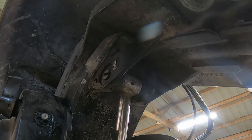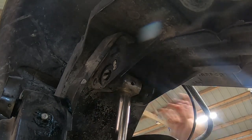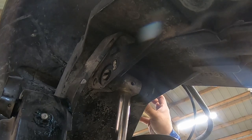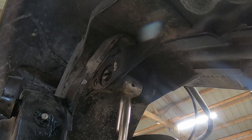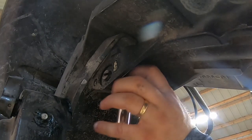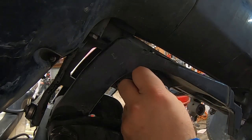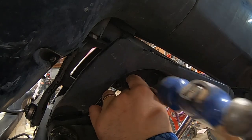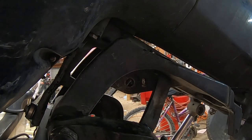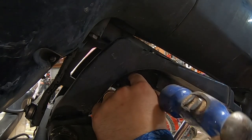That was easier than I thought — here's what it looks like out. If you're not resting on your safety you'll probably have to do that here. Once you get that rested on the safety, this rod should be loose. If you're replacing an existing bushing and need to drive the old one out, a socket that fits inside that hole would work well to tap it out. Mine happens to be a 13 millimeter that fit pretty well — I checked it on the other side where the bearing bushing was missing.